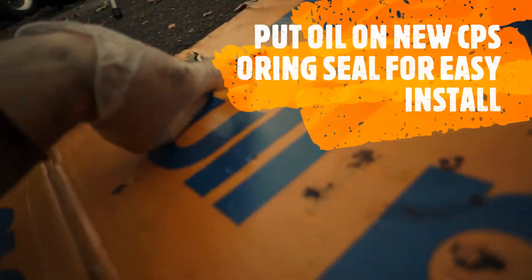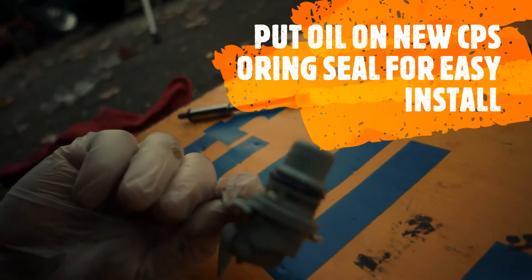I've got the brand new sensor with a little bit of oil around the seal, and I used a rag to clean off the orifice up there. I'm also using dielectric grease on the connector side. Let's put this new one back up inside there the same way it came out — just wiggle it in gently, don't force it, let it seal up with the little bracket. Boom — slid right in. Move that little tab into place and we'll get the screw in.